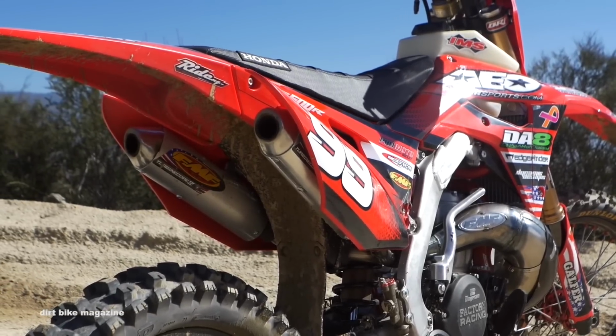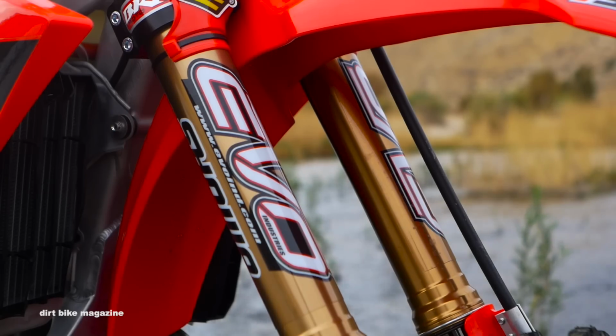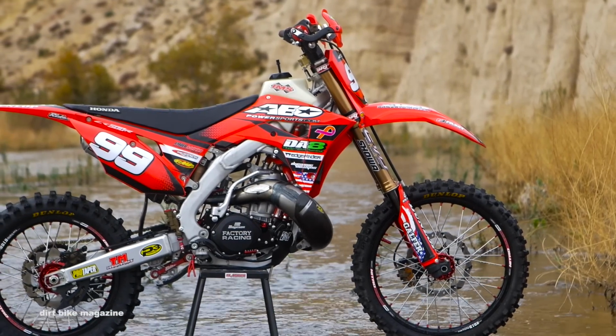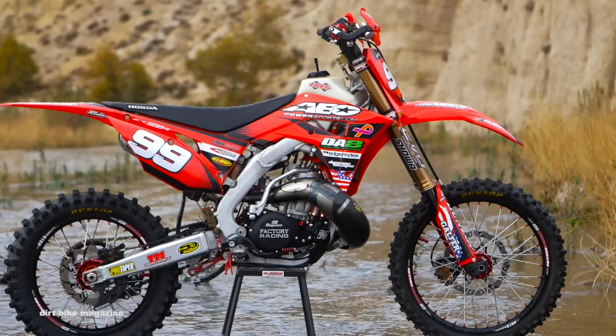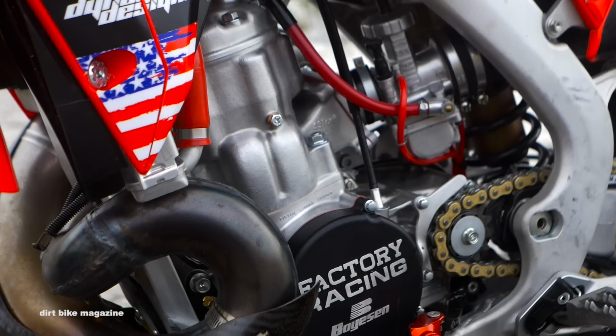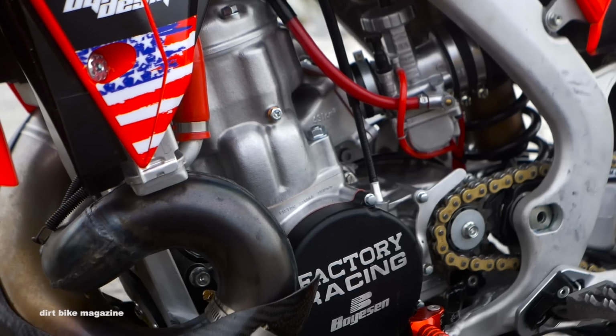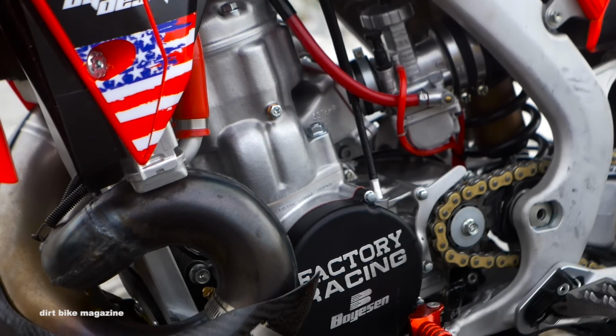Evo's suspension handled revalving the fork and the shock. And in the rear, the shock is more than just revalved and resprung. It's actually a hybrid of a couple different shocks, allowing it to have clearance on the air boot and the dual exhaust system in the rear. Edgefinder also did their magic in the refabricating of the air boot, making it line up perfectly with the carburetor.